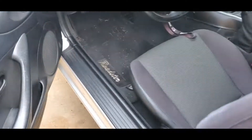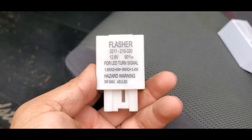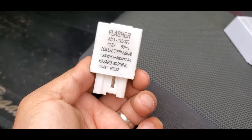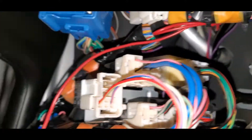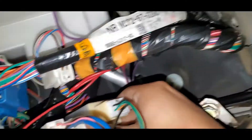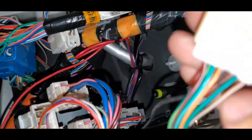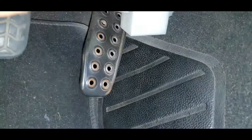I'd honestly recommend disconnecting the battery before you start doing this. This is an LED flasher that replaces the OEM flasher that you're gonna switch out. The OEM flasher is gonna be here — sorry if the angle is a little weird, let me turn on my light. Some cables look different because my car is modified, so ignore that. This one here is gonna be your flasher.